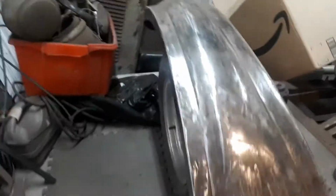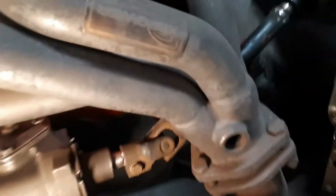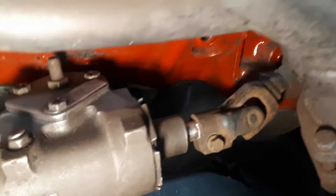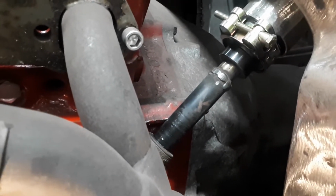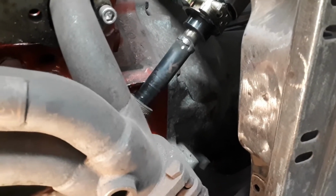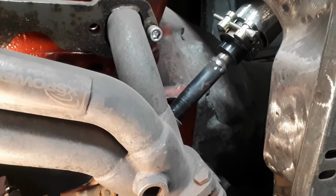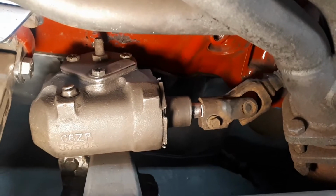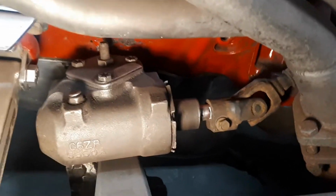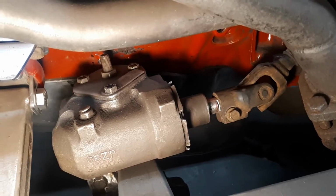And then out here I have the steering column hooked onto the steering box. It's a setup off a Jeep Patriot, something like that, one like an 08 to 2010. All I did was mount a bearing in the bottom of the steering column to stabilize that, and just used like a clamp to hold the bearing still. All I had to do is cut 2 slots or 2 flat spots on the shaft that comes out of the steering box, to match the universal I got from the Dodge.